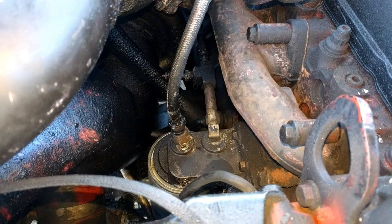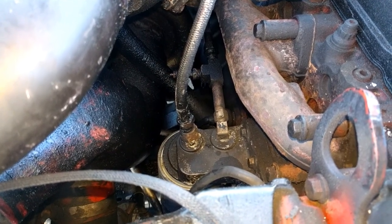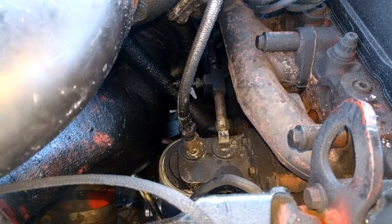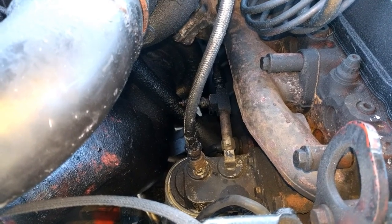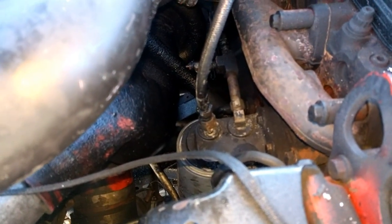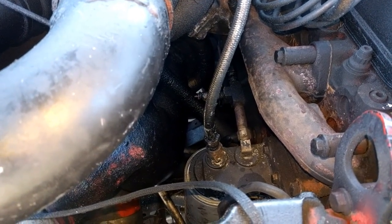You need to check those things first — it's the easiest thing to do. What I did is, I thought I'd stick in a new oil pressure sending unit to rule that out. For some reason Dodge has different ones for different vehicles, and when I checked mine they want over $200 aftermarket. So I picked up a mechanical oil pressure gauge from AutoZone for $17. I'm just going to T into the outlet I already have here — you probably have a plug there unless you have compound turbos. I have compounds on here, so I'm just going to T in and hook up the mechanical gauge to verify they're saying the same thing.